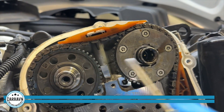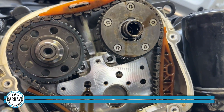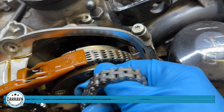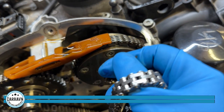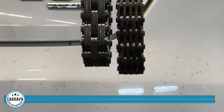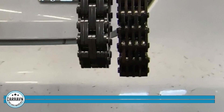As the tensioner fails, it does not exert enough pressure on the chain, causing the chain to elongate. The chain's job is to keep the camshafts and crankshaft in sync — if it elongates, you're done. We do not use an OEM Audi chain for this repair. The updated kit has a different design with two links, making the chain a lot sturdier and stronger so it does not stretch over time. Here are the two chains side by side: the old chain on the right is clearly elongated, and the new chain on the left has the updated two-link design.